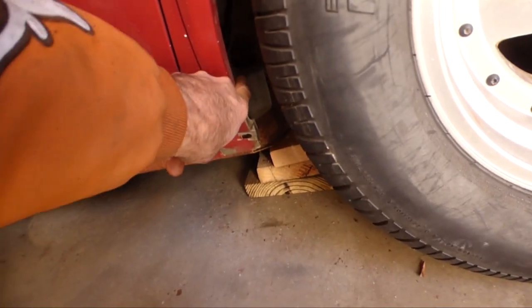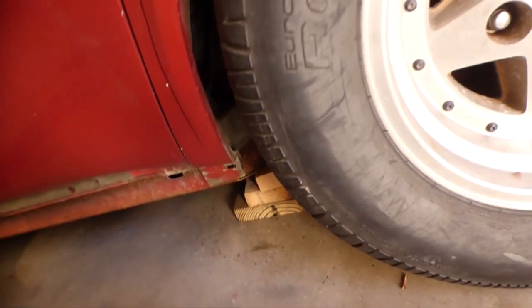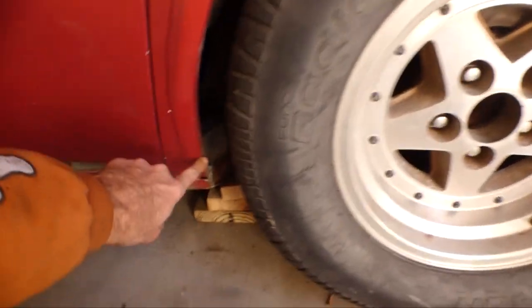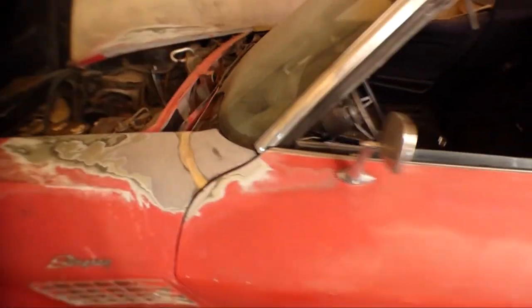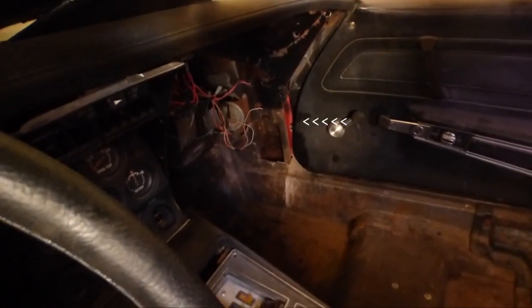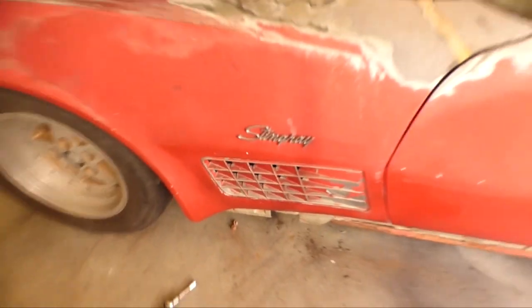I had forgotten a couple of body mounts. There's a body mount right back here that needs to be undone, besides the one that's up on top here. Okay, so you got 1, 2. There is a third in the kick panel inside. I don't know if I can show you over there. There you go, that kick panel down there, both sides. There's a third one there. And then of course the fourth body mount is behind the grill. Okay, so all those body mounts are off.